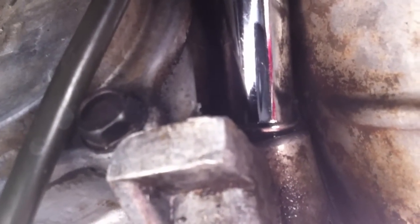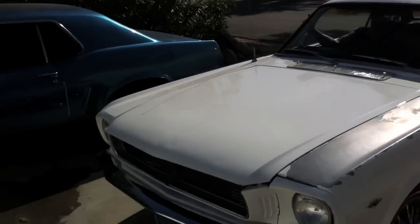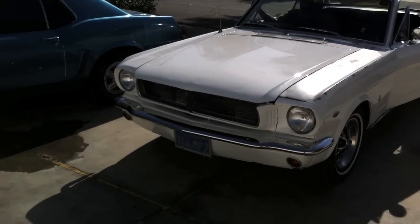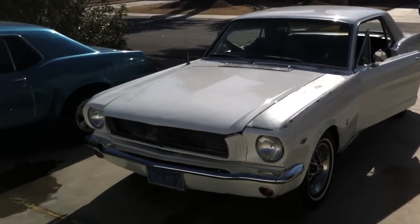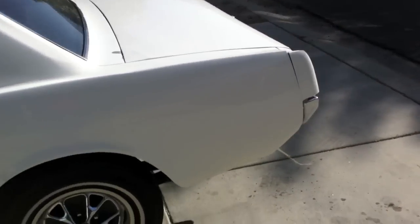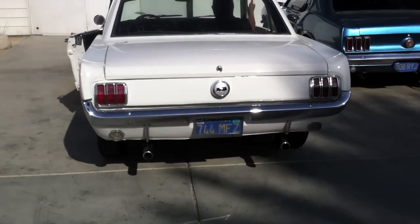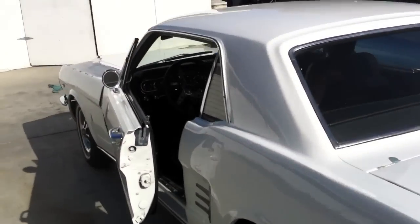Might as well do a chrome pan anyway. The filler tube does have an O-ring and we put silicone on it, but it does appear a little wet, so I'll wipe it down real good and also wipe down the gasket all around the pan. Then we'll take her for a drive with Pete to go get parts for the '71. I made an adjustment — it looks like the adjustment screw walked out a little, so I might get some small lock nuts, but the idle seems to be working fine now with just a simple tightening of the idle screw.